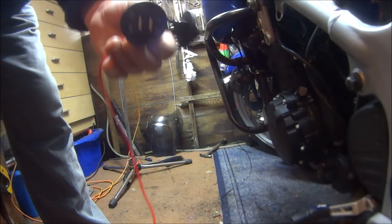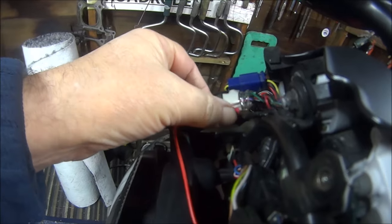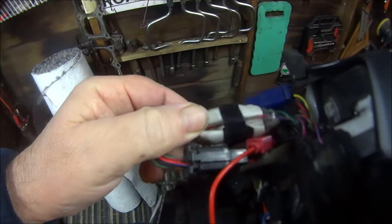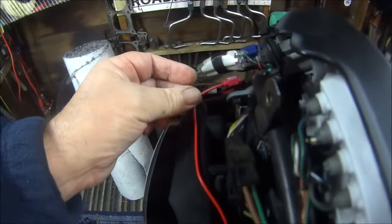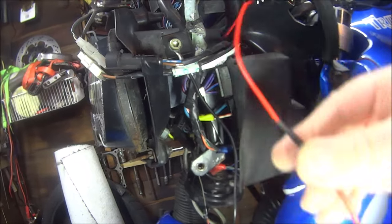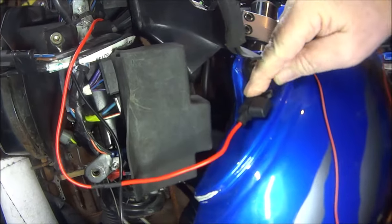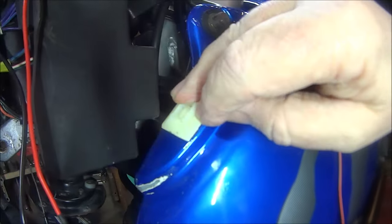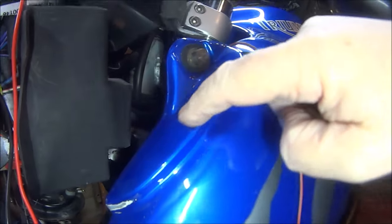Now I've just got to find a switched live — these only come on when I put the ignition on. We've found a switch wire: it's the green and red coming out of the fuel gauge. Not sure what's all going on there — don't know if that's factory or been put on later. But anyway, that's going down through the clocks and coming out through here. I'll probably make that a bit shorter. Now this fuse is going to go there behind that little panel. I'll put a couple of wire holders on — stick a zip tie through the split and the fuse will be held nicely just there.